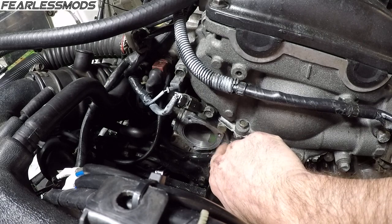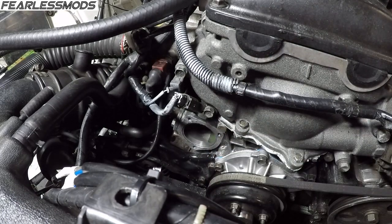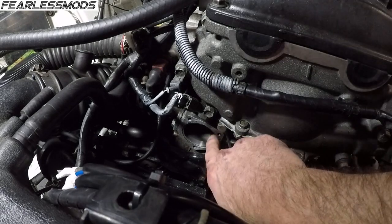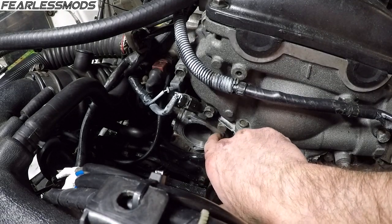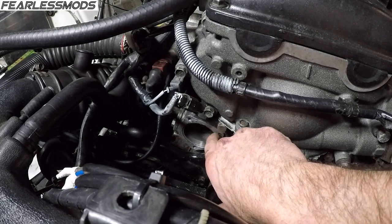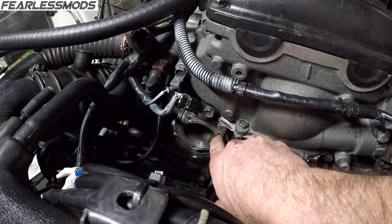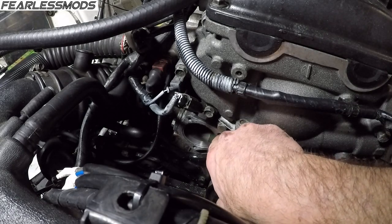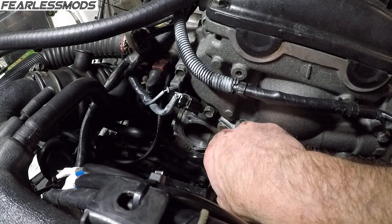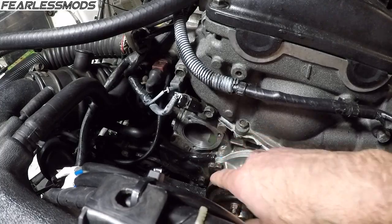So now that that's in there, we will let that Loctite harden up. I'm not going to use brake cleaner anymore because I don't want to weaken that Loctite. I want that to do its job. So we get in there and blow around with an air gun just a little bit to try to get that little piece out before we install everything. But for now, that's the installation of the Helicoil.